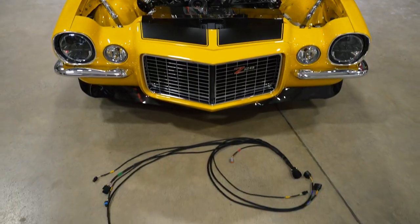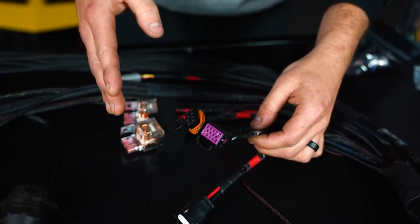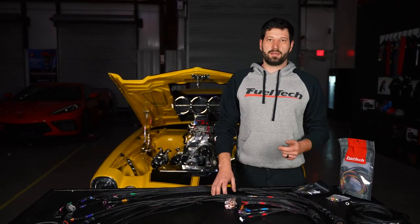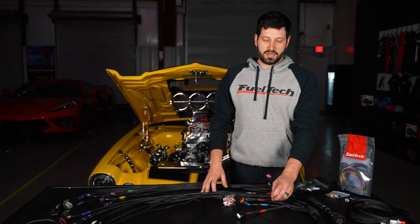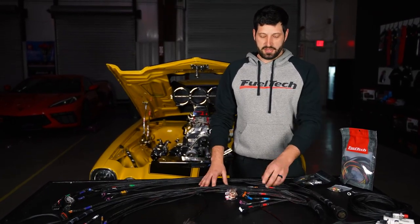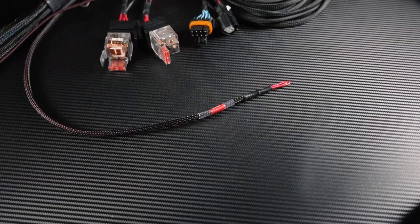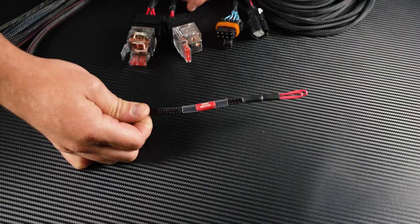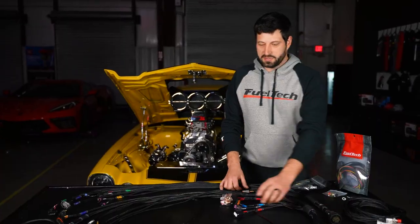This is a terminated harness. We have provisions already for fuel injection if you want to swap to fuel injection later, or extra outputs for nitrous — like a solid state relay for progressive nitrous, or an extra output for a two-step trans brake. You name it, you can do it. It's right here. You also have ignition outputs if you want to run single coils or plug into a CDI box. Another nice feature is the nano switch wire: if you want to keep the ECU running while the car is off, you can cut this wire and run a separate switch to heat up the O2 sensors independently.